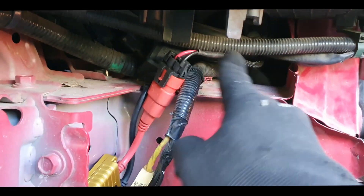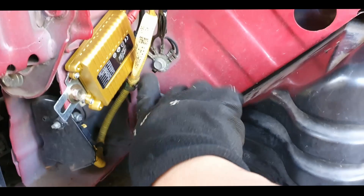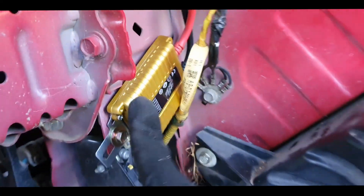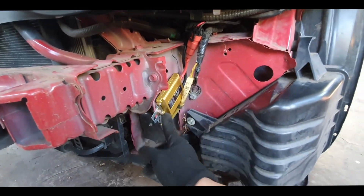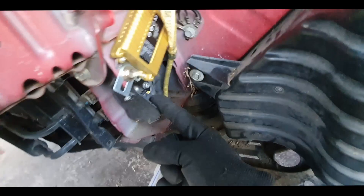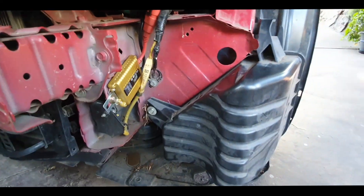Bumper and the headlight — if you look on the inside, everything is still connected like normal. Lights are in there and it goes with a nice clean look. It goes where all the other cables go, all the way down and into here. I've mounted it just on this little bracket here. The original bracket came with the HID bulb and I just put a 10mm bolt I had spare right here. I was considering attaching it near the grounds, but the cable wasn't long enough for the ballast, so I mounted it just here underneath the headlight. Right underneath all the original negative terminals and the air box — that's where I mounted it. You could also use the original alarm mount here, but you can pretty much put it anywhere. You can cable tie it as well, but cable tying it will become loose, whereas this mount is very solid.